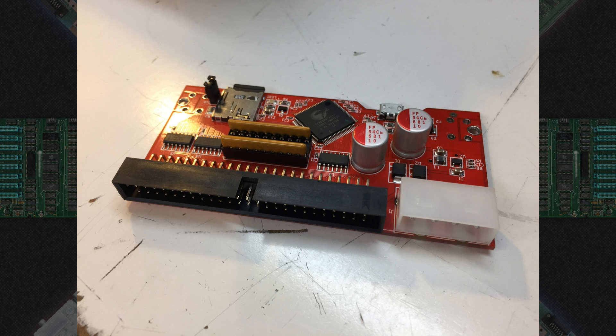Before I started with OS2, I wanted to preserve the contents of the hard drive. I figured the easiest way was to just replace it, and the best way to do that was a SCSI to flash memory solution. The device I used is literally called SCSI2SD — it's a custom board that connects to the 50-pin internal ribbon cable of your system and emulates a SCSI hard drive.